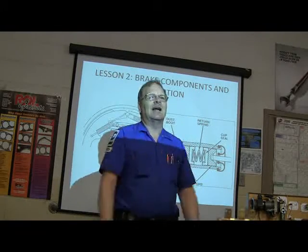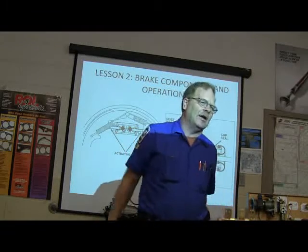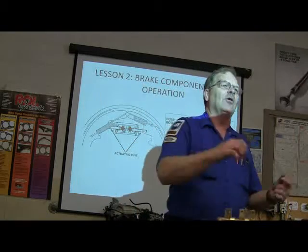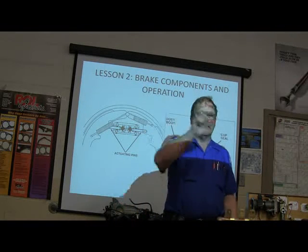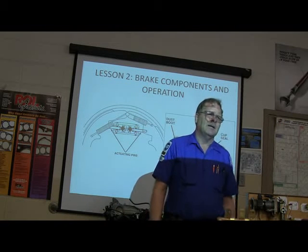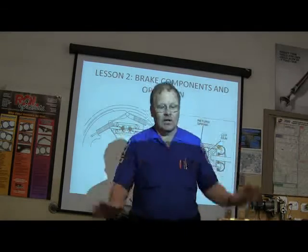It's covered with that black dust that will give you cancer if you breathe it, mesothelioma and all that. So the first thing I want to do, if I don't have anything else, is pour some water on that and wet all that dust, because wet dust can't fly. Brake parts cleaner works well, but don't breathe that stuff in, because it's like smoking 10,000 cigarettes and it's not near as much fun. You got me? All right, so you spray that stuff on there and then wash all of that off.